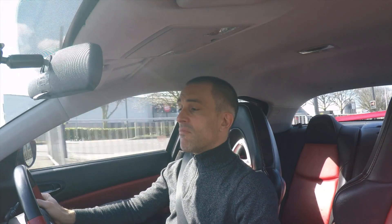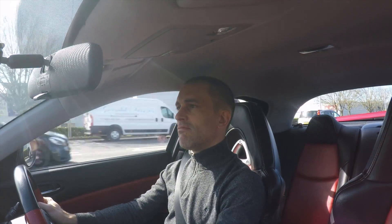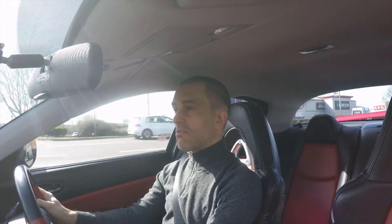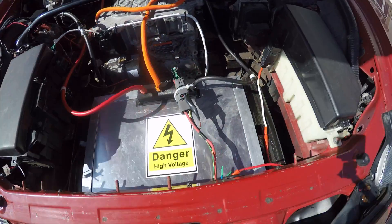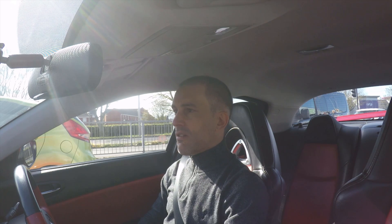Let me show you. Second gear, going 30 miles an hour — third gear, off we go again. Strange. And I can knock it back down to second gear, back up to third gear. I don't need a clutch. Because I have so much torque, I can actually pull away in third. You try and pull away in third in any other car, it doesn't really want to know. But you can put it in third and it's a little bit sluggish off the line, but gives you a much better mid-range. On the dual carriageway where it speeds up to 60, third gear is where it's at — all the performance and good range of power. Second gear, you're right at the top of what it can do, and at 60 you're kind of done.